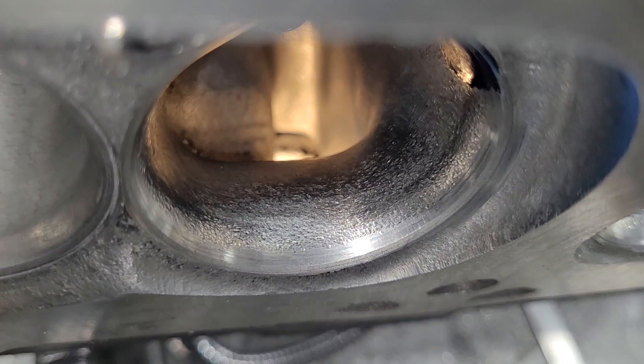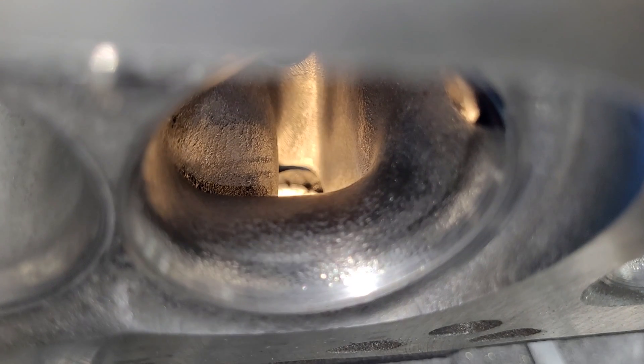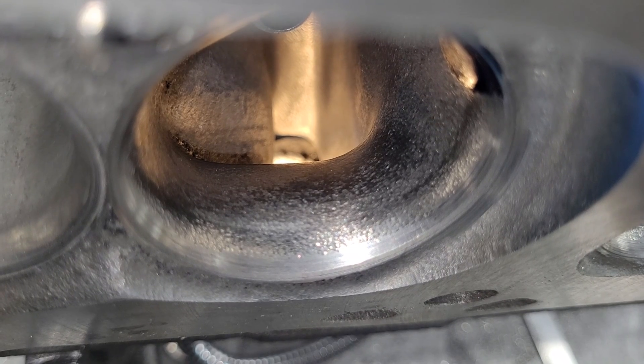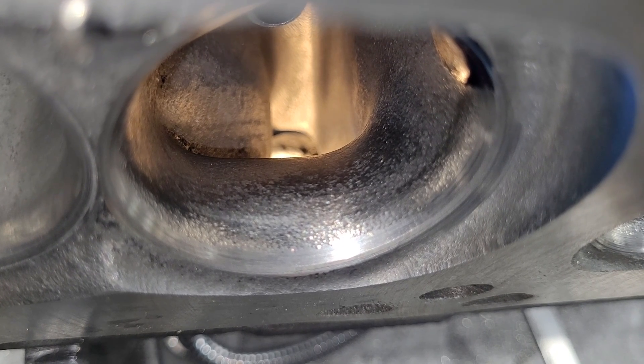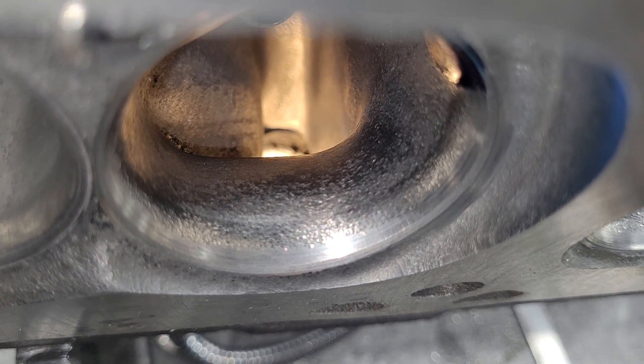The short side radius is not polished — it's still burned because I'm finalizing the shape of it. It did get laid back, it didn't get much of the apex taken off, and it was brought out a little bit wider because of the excessive air speeds. Well, guess what — that didn't help.